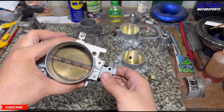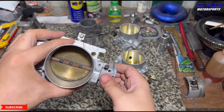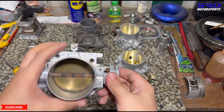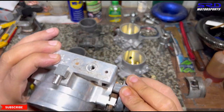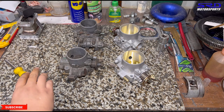The original Allen bolt also has a double nut, so you have to make sure that's tightened and won't loosen up over time. You can see here the full throttle stop is not even touching — so the throttle plate goes past full throttle and actually goes back to closing again, which is a problem.